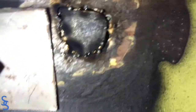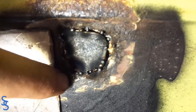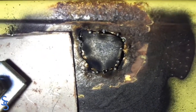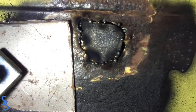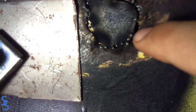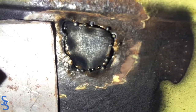Two things to look out for when doing this: first, the metal of the car has been thinned out, so wherever you're adding new metal, you want to go lower on the heat and speed. I found this out the hard way — I started in this area with the proposed heat and speed and actually made a hole. So be careful with the heat, speed, and wire that you use.